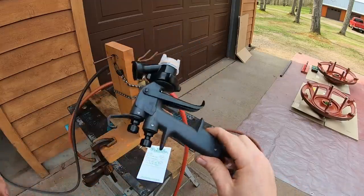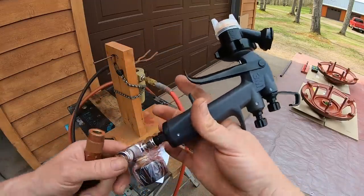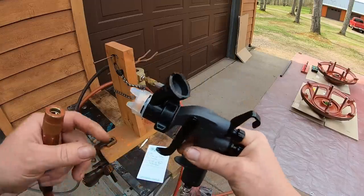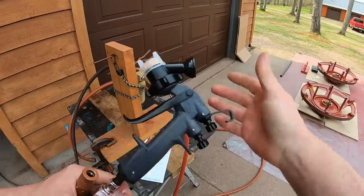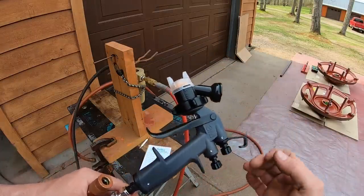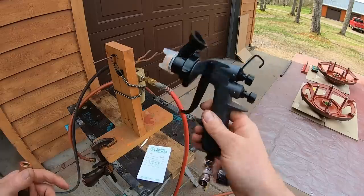Also today, more paint gun adjustments. I'm getting used to this new 3M PPS gun. So far, I like it. There's some things I really like about it, like the cleanup. When you take the cup off and then take this replaceable nozzle off, you just have whatever misted on the body of the gun and a little bit of paint on the needle to clean, and you're done.